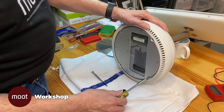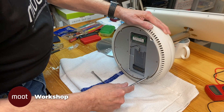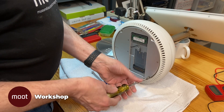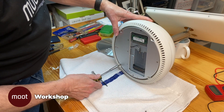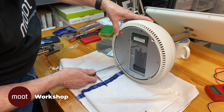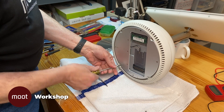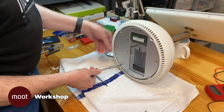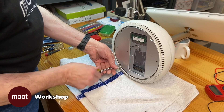When you're working on one of these, you don't want to touch anything in here — not the RAM, and you don't want to touch anything inside the box unless you have discharged any static electricity that may be on you. Even if you think it's too humid for static electricity, believe me, you are mistaken. There's always some, and static electricity can murder these solid-state devices. At the very least, ground yourself on the case before touching anything inside, and it's even better if you're using an anti-static wrist strap connected to a ground.